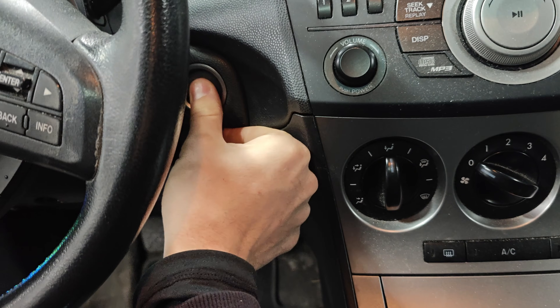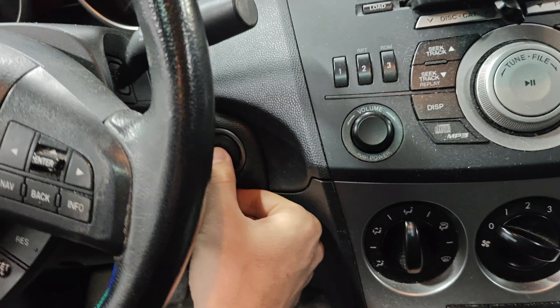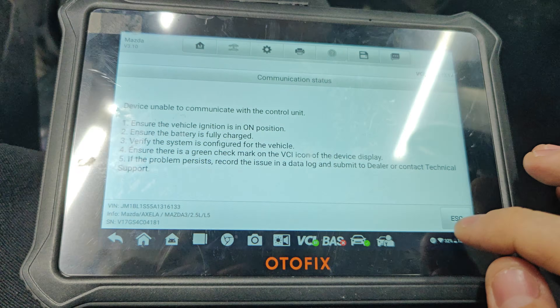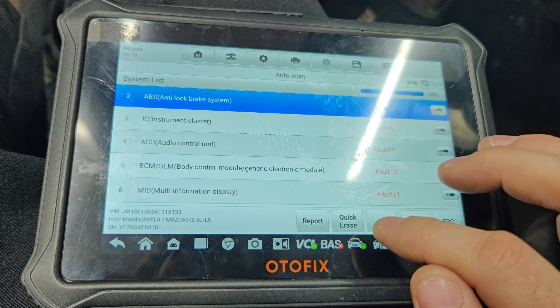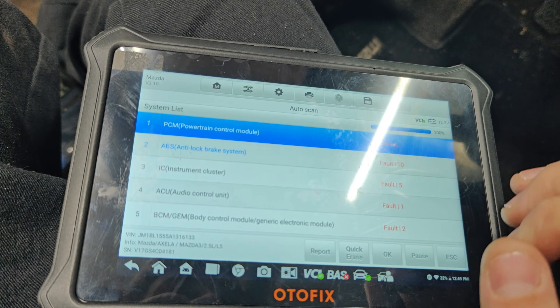This fuse isn't blown - let's move that over and see what happens. Oh, now it turns on and off! Look at that - so that works. Now we can read the anti-lock brakes. That's weird because I didn't see that on the diagram.